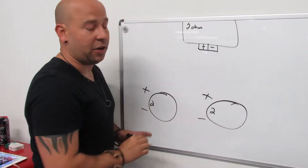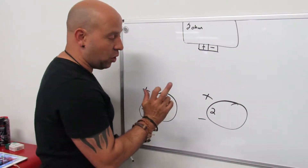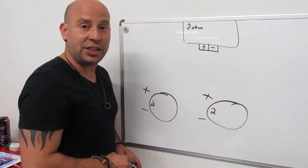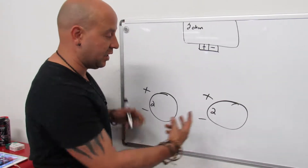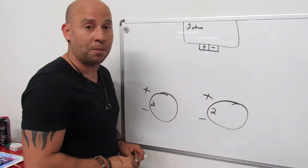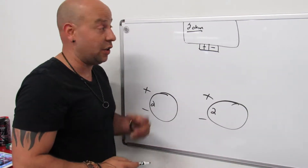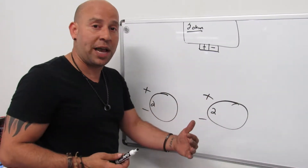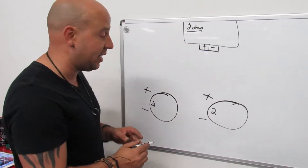If you're here in this video, it's because you have one amp that is 2-ohm stable and you want to wire two subwoofers to it that are single voice coil, each at 2 ohm. We're going to wire this as a series circuit — not parallel — because bridging them together would cut it down to 1 ohm. Anything less than the amp's stability impedance is going to fry the amp, so if your paperwork says 2 ohm, do not wire it below that.